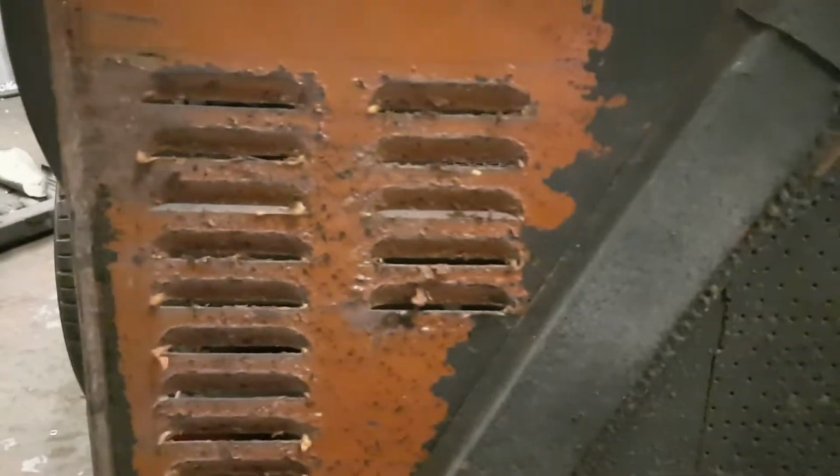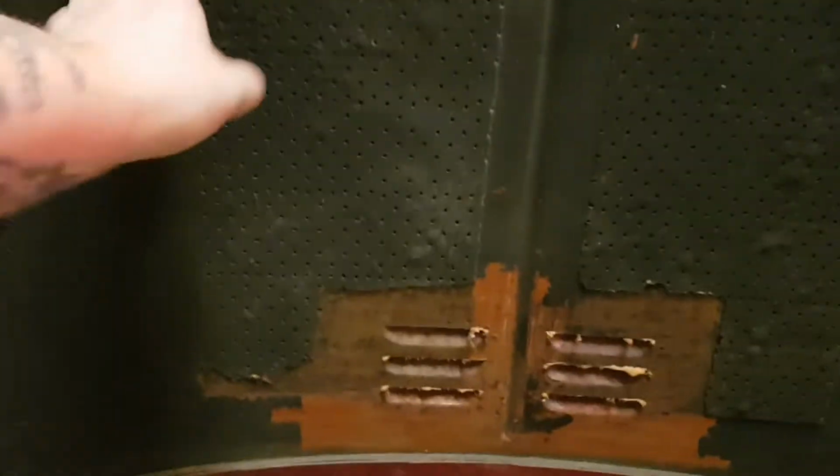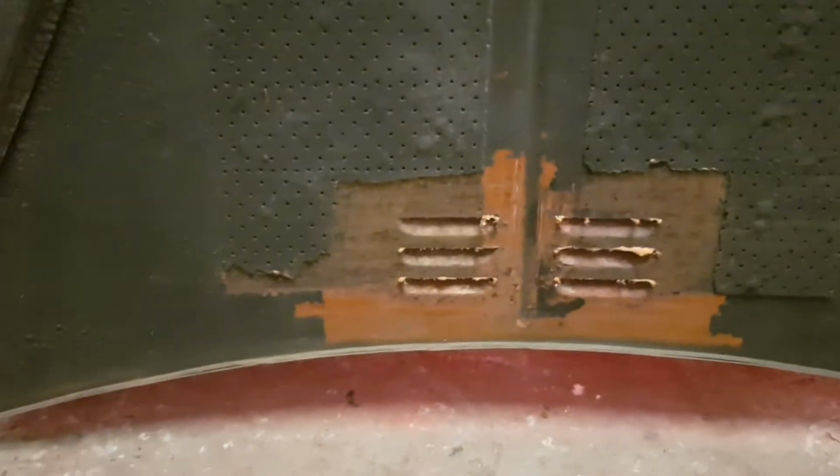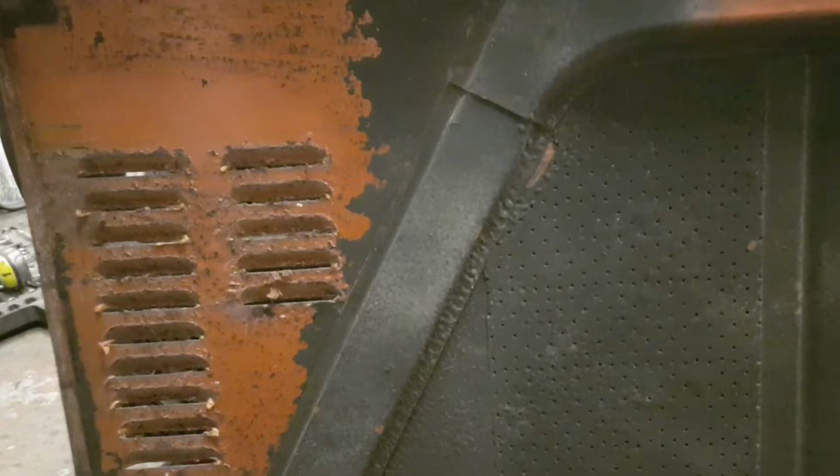Now guys, the top side of the bonnet is done. So on this side, there's not really much left to do. It still has the sound deadening and the bonnet strengthening. That's this kind of layer here. It goes hard once you put it on. So I might just sand this down a little bit and just spray it black and then seal it. That's pretty much it.